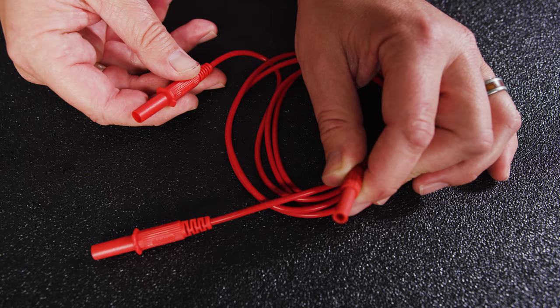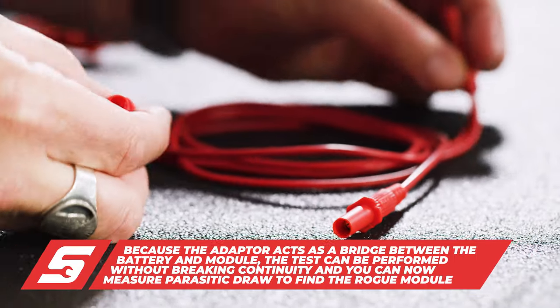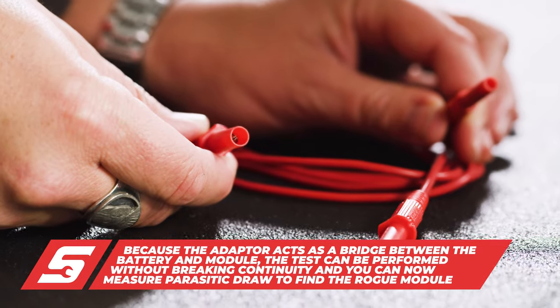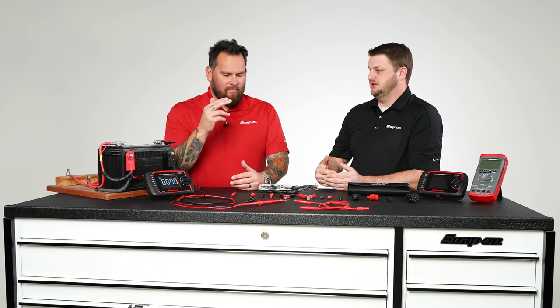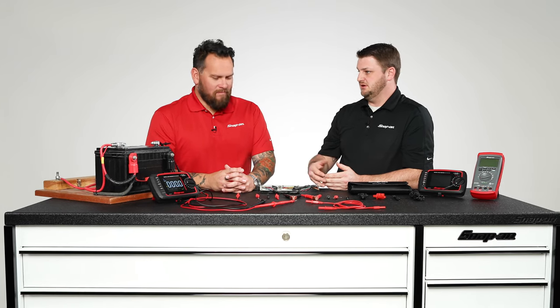This is exclusive — a three-port source wire for your highly skilled technician who really needs to diagnose problems. It's great for diagnosing parasitic loss: hook up to the battery, pull the terminal off, and maintain continuity to the system to figure out what is drawing on the system and how much. For example, if you see two amps on your multimeter, you might look at a lighting system. If you're dealing with something around 50 milliamps, you'd look for maybe a sensor — like a seat memory sensor drawing power while the car sits. It's a really neat way to hook in and diagnose what the issue is before you start attacking systems.